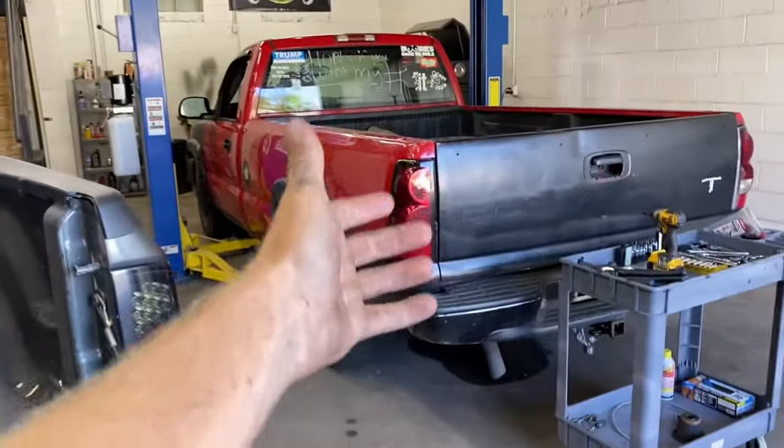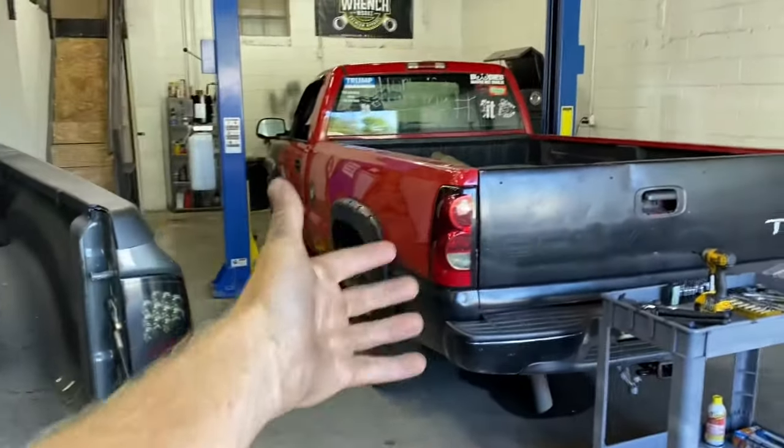Yes, I know. The 5-speed was never offered with the 5.3 engine. But that's okay. I think I said it before, but if you choose to go the route that I'm going and you're using a parts truck, your slave and master from a 4.3 or 4.8, either one, will work for the application. You can use either one, six cylinder or V8, so long as it's basically the same year model, like mine, 99 to 07. There's a couple different types of slave cylinders, but they will interchange.